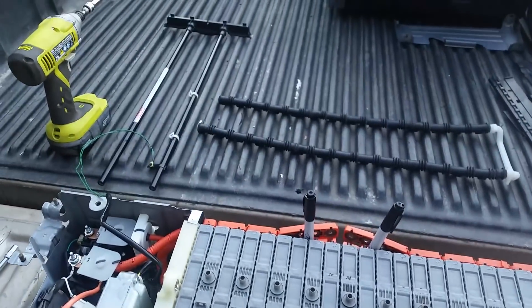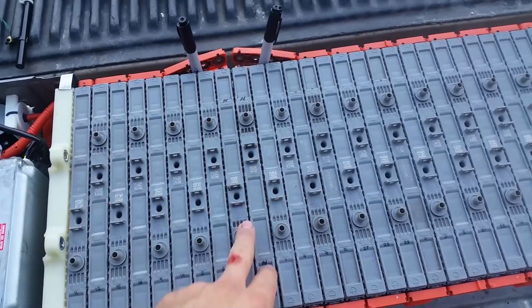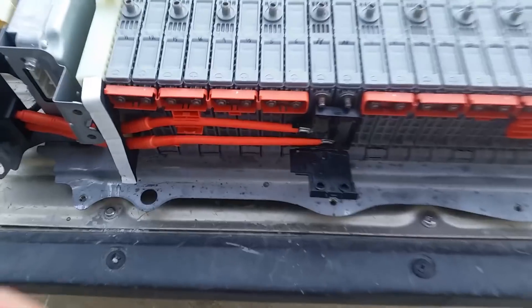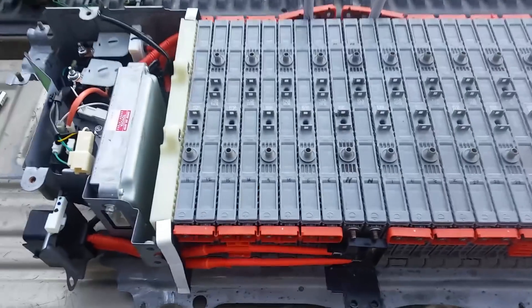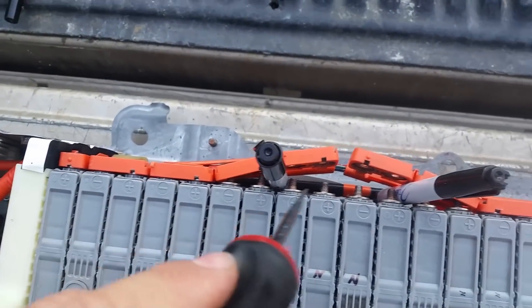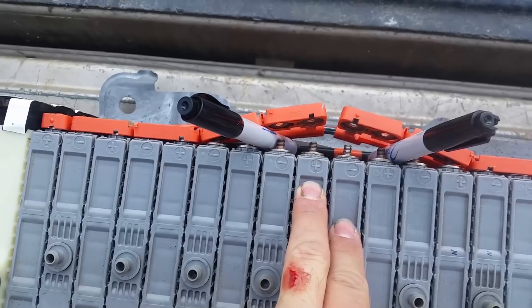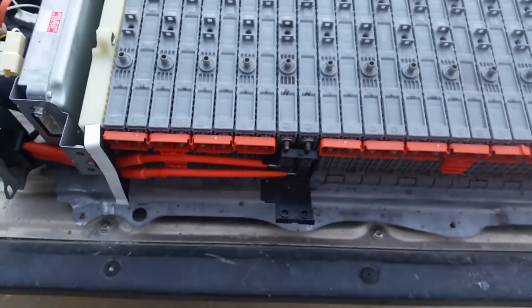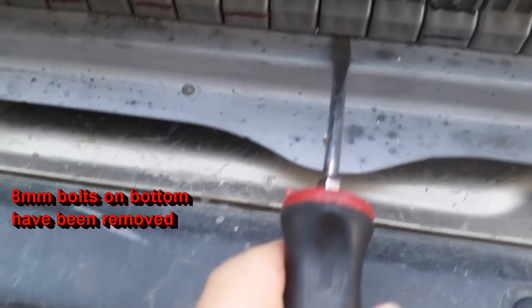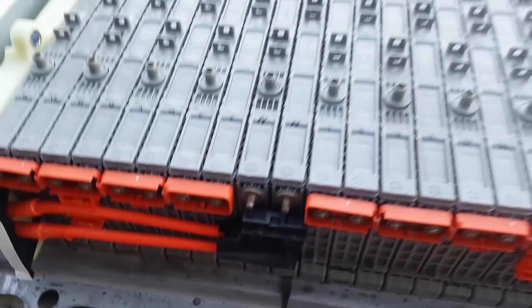With everything off — your bars, your vent hoses — I'm gonna try and pull just these two cells out. Depending on wherever you have bad cells, let's see if I can get underneath here with the jumper side disconnected. Wherever you have your bad cells, let's say you pry off and take back three or four on each side. I've put some sharpies in here so this is held apart and disconnected, and I'm gonna try and see if I can go underneath and pry up.